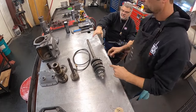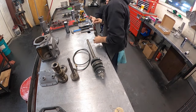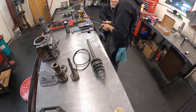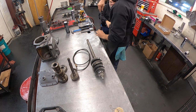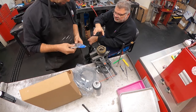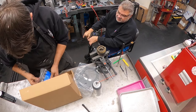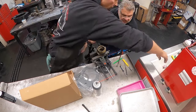Let's start with the front. Grab that quill with the bearing. With the flathead screwdriver here, you've got to go from the front and knock that seal out in there. Go in from the top and get an angle. It'll be a small pack of like 10 or 12 bearings - it'll look like a little hot dog. Put them in a tray so they don't roll everywhere.